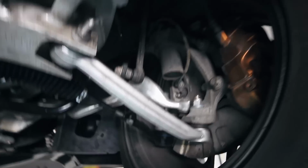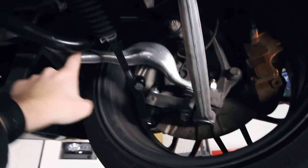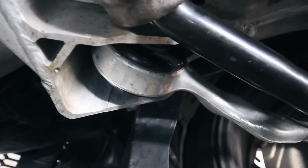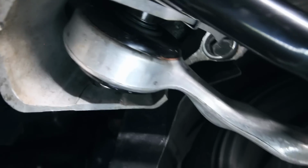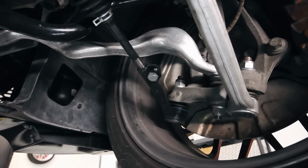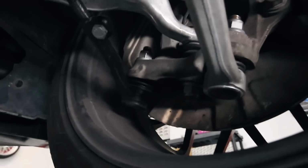So you'll notice we've got both the M3 front control arms here, right here and here. And if you look up in here, this is that precision bearing kit on these lollipops. They come with the OEM M3 bushing in there, but we put Bimmer World's precision bearing on the front of both of those. I've also got all new tie rods here in the front. These are all crusty and old and rusted, so brand new there.